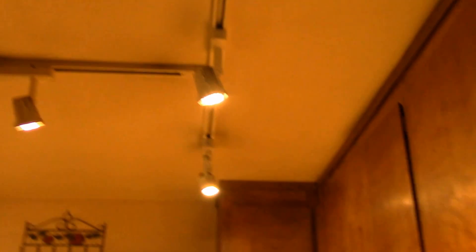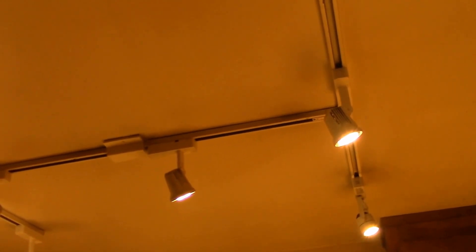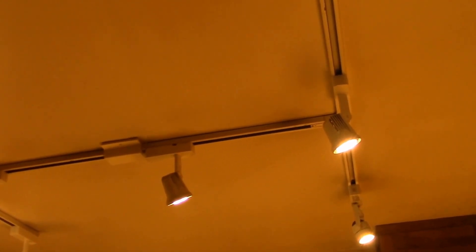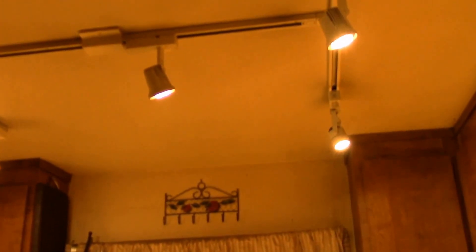I was just looking for a little more light. These LEDs are a little narrower beam than the halogen bulbs, so you have to have a few more. I've got five-and-a-half-watt times seven bulbs, so that's 38.5 — about 39 watts. I've got a five-amp fuse for this circuit, so I'm still under the five-amp fuse and I've got plenty of light.